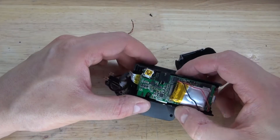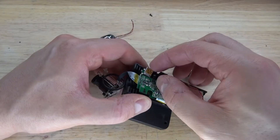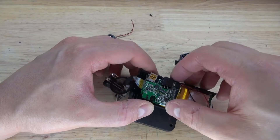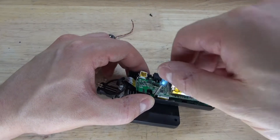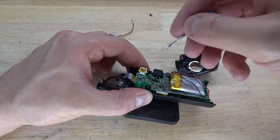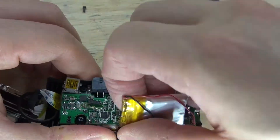Now let's go a little deeper. I think I've found part of the problem with this camera. This little connection that recharges the camera is broken — it's desoldered, so what I need to do is re-solder it in order to get this camera to work. The batteries are probably not good either, so I would have to replace those too. But I'm not interested in repairing this, so I'm going to just simply remove all the screws and see if I can find any parts worth salvaging.